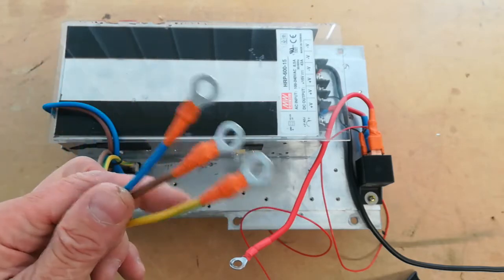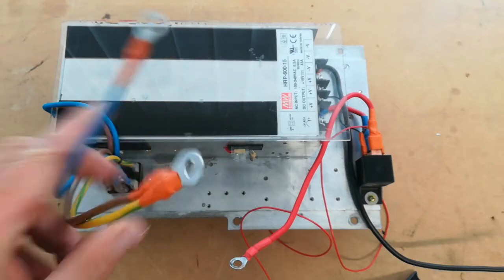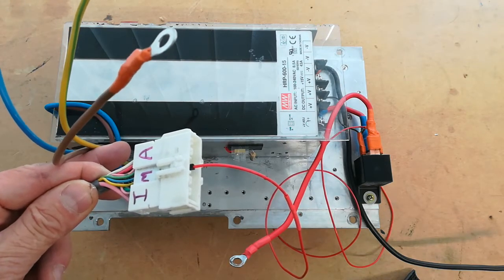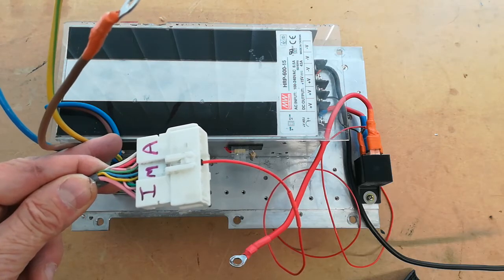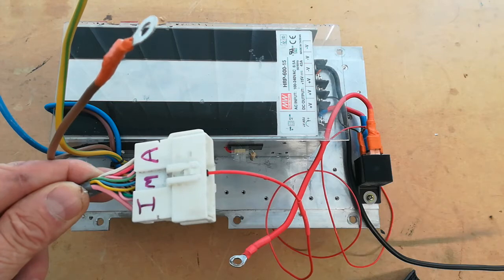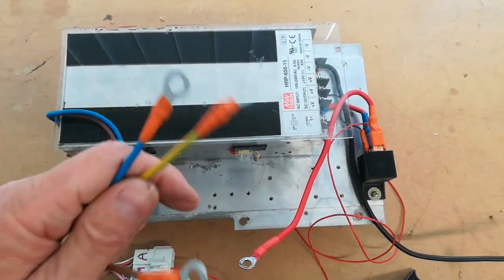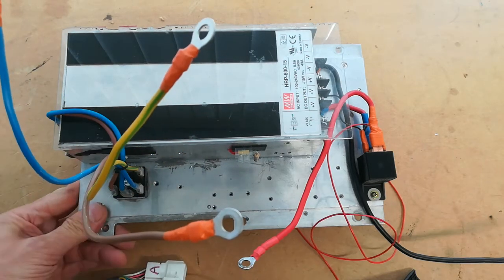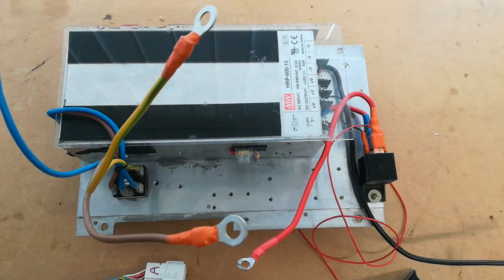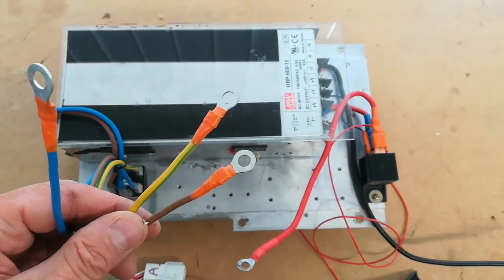This is the method of running the car without any IMA and without having to fit an alternator at the front. Obviously if you use this with the IMA disconnected, there'll be a plethora of codes on the display and the car may have some reduced functionality — I haven't tested that. But it will charge the 12 volt battery, so it is possible to run the car like this as a temporary solution, or for someone who can't afford to get it fixed. It has worked in the Insight, the Civic, and other IMA cars, though with later CAN bus IMA cars you do get codes on the dash and can't pass emissions or MOT.